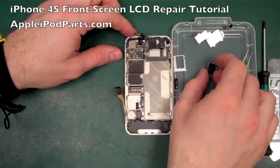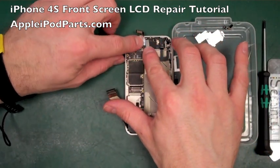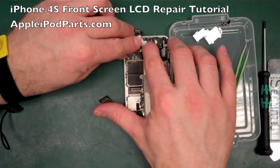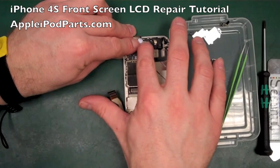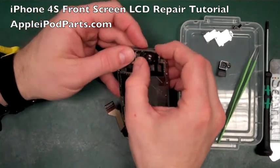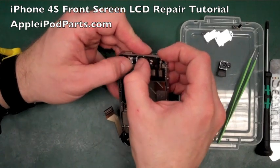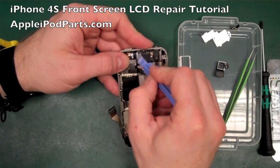Camera next? No, we'll put the screen cables down. Now obviously we're going to fold over those, and that screen connector, again with your finger, it needs to find its own way. I think that's the digitizer's found a connection then. And then we're going to fold over the LCD, nice little click and click, and then we'll just rub over those as well. Happy they're in place.